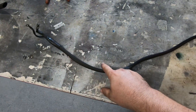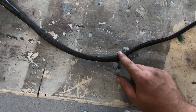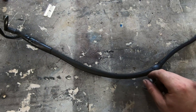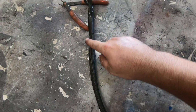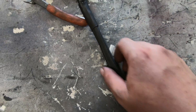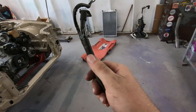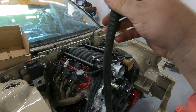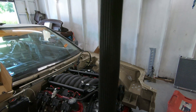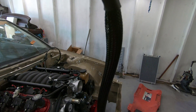The alternator wire needed to be a lot longer; the starter wire didn't need to be as long. The starter wire goes right here — and this entire length has a nice braided plastic shield on it. From here to there it runs behind the header, so it goes through the firewall, and that section is actually plastic and heat wrap for heat protection. There's also heat shrink on the end right here so it'll never come apart, sitting right at the starter. Everywhere it's near heat — by the header — is protected.